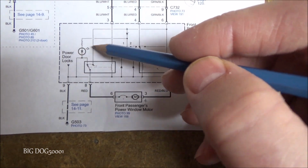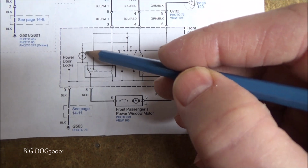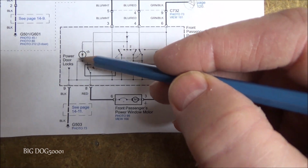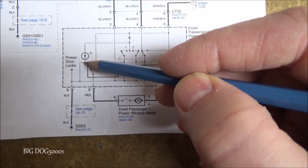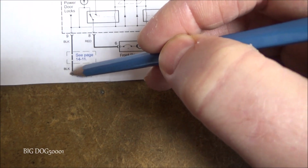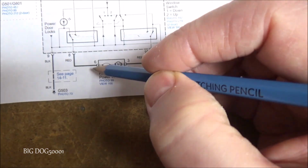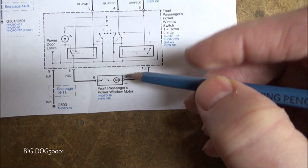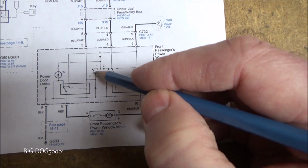That's another diode. And you see these little squiggly lines with an arrow. That's light, so this is a light emitting diode. So it's not going to go that way. Then our power is going to come down, or I should say our ground, and you can see we're grounded. So that means when we press the button the way we did, we have ground over here and we have power over here. Now let's press the button the other way.